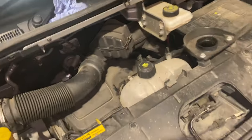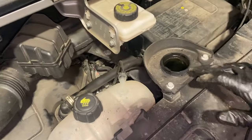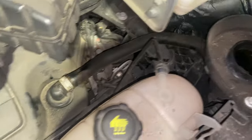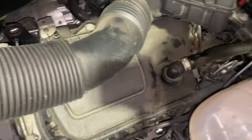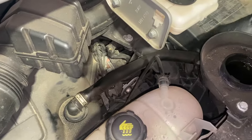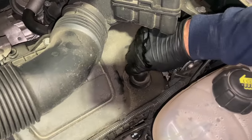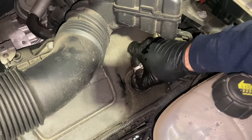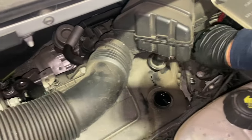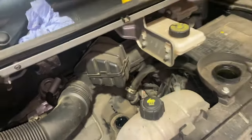We're now ready to fill the oil. It takes exactly six litres of 5W-30 fully synthetic oil. The main filler point is there but it's a bit of a bad design on these — it tends to clog up in the pipe and airlock, taking ages to fill. So I always just undo the cap here and turn it round as far as it'll go with the pipe, and pop it out that way. Then just use a funnel and pop it in there to fill up with six litres.